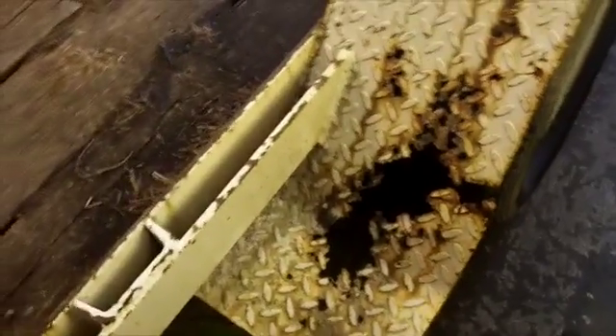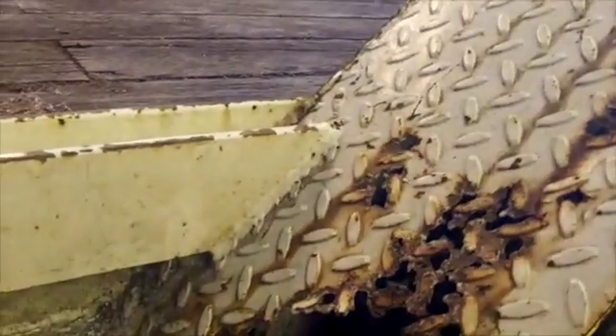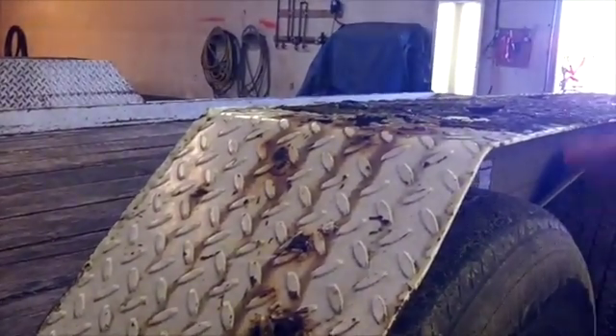But this is the one that's real bad. What I'm going to end up doing is taking the plasma cutter and cutting across up here, then right down along the edges where it goes up to the frame and right down along here as close as I can get, then grind that flat. Then we'll finish cutting the rest of it out. I'll probably have to section it in about eight inches up to get rid of that. The rest of the fender is in good shape. We talked about replacing the whole thing but I think we're going to skip on it. He has toolboxes that go on this, and this is chassis grease smeared all over here — tar kept them from rusting out on top. But I think this fender got whacked there, broke the paint, and maybe had the torch put to it to straighten it out, so it rotted. We'll have to get all the goop off these fenders before we take the plasma cutter to it.